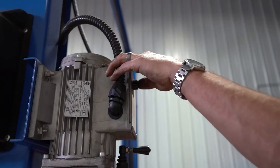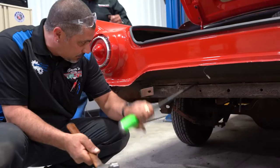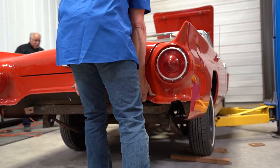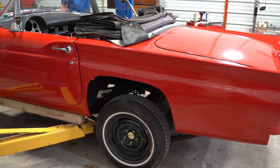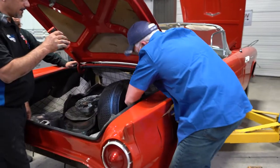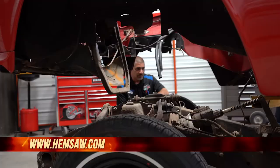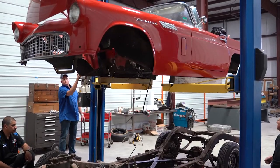As we begin to lift up, we'll check to make sure nothing's attached and the body's coming off properly. If we hear any binding or anything that doesn't look right, we're going to stop and figure out where it is. This is a perfect example — we thought we had every bolt out, but as we slowly lifted, we could tell the rear of the car was not separating. We pulled everything apart in the trunk and noticed there were hidden bolts we didn't see. So now we'll take those out and slowly continue raising. When you guys do this at home, take your time, go slow, and you won't have any issues — you are going to run into a few stumbling blocks you don't expect.